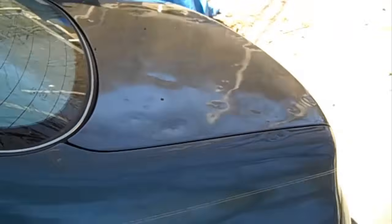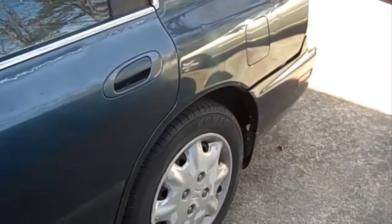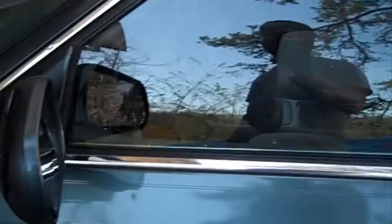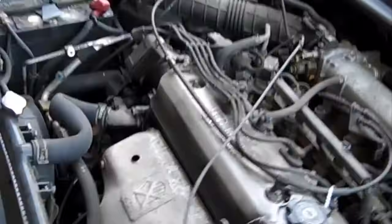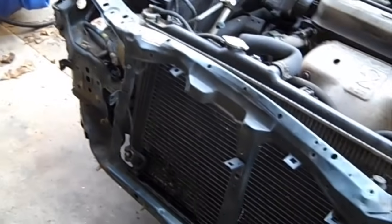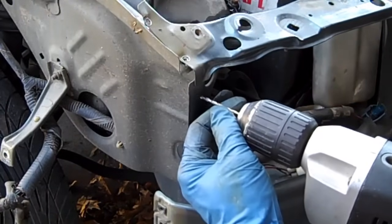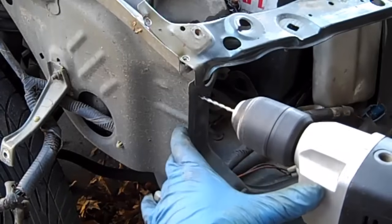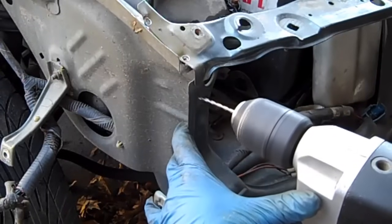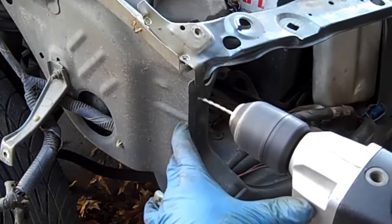As you can see, this car is damaged from end to end — faded and peeled. The owner just wants a front end put on it so they can drive it or sell it. Unfortunately the radiator support was pretty heavily smashed, so the only way to put it back together is to change it out. Now I've center punched them, so I'm going to drill them out. It helps if you have a variable speed drill — the drill bits actually cut better at a slower speed, which keeps them cooler and keeps them from burning up.